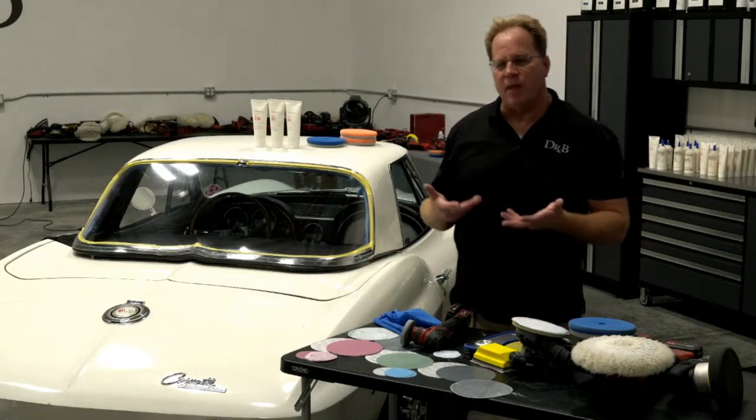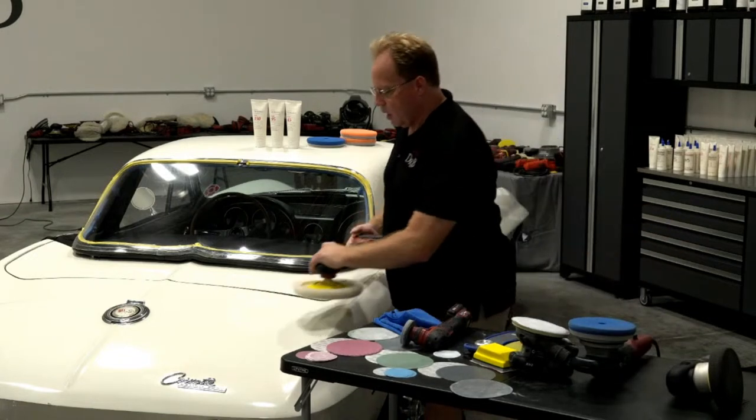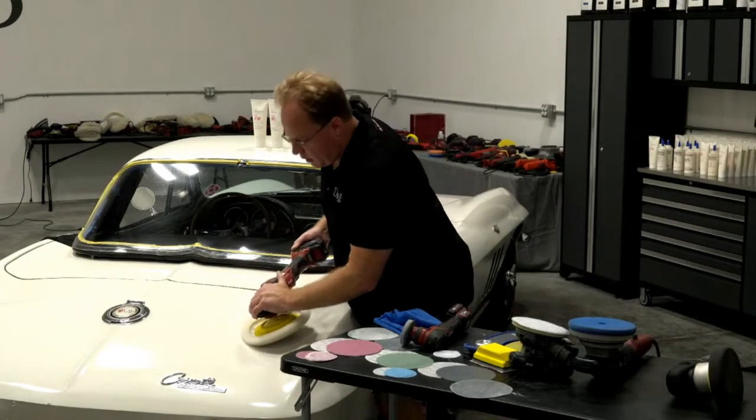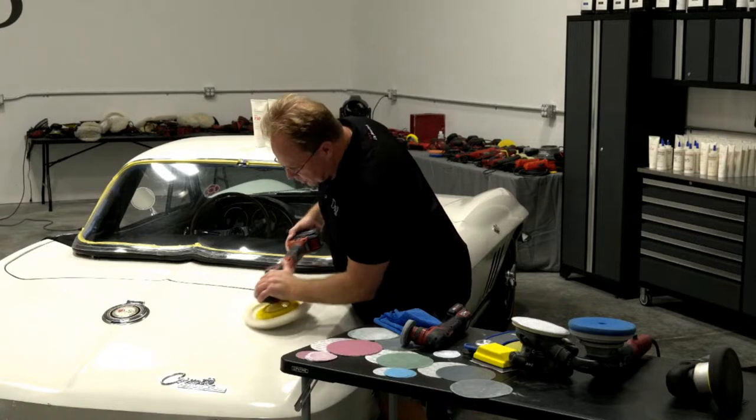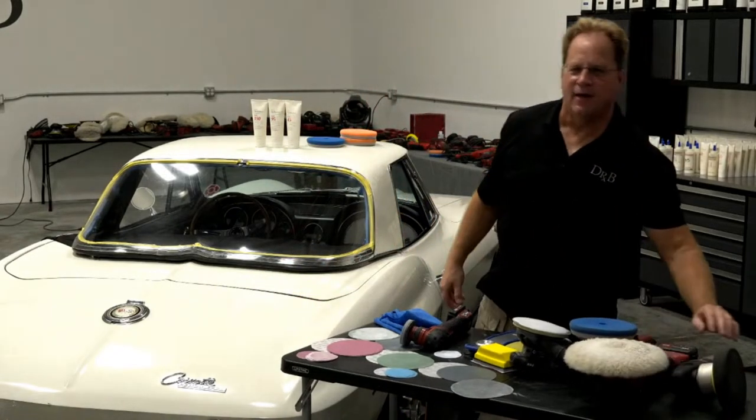The bigger point is that when I pull those sanding marks out, I'm taking this tool here and I'm pushing on it. I'm pushing down about 10 pounds of pressure. Oh, we got a shiny spot in the paint now. Now I've got to do the whole car.